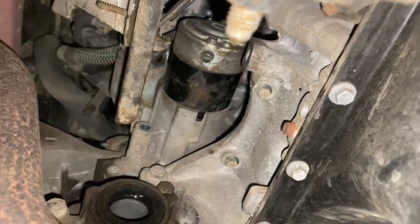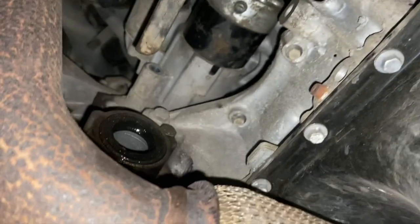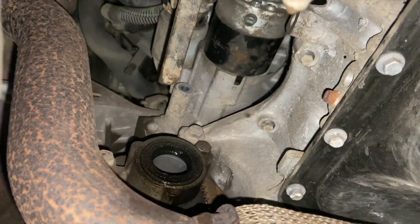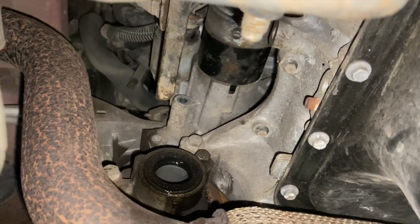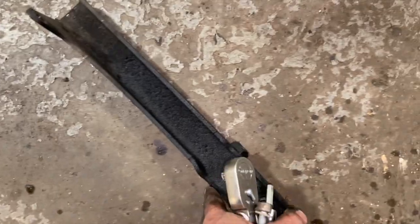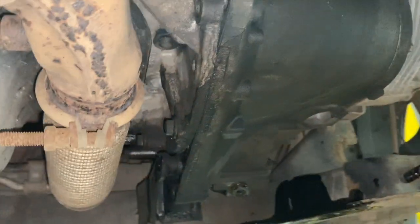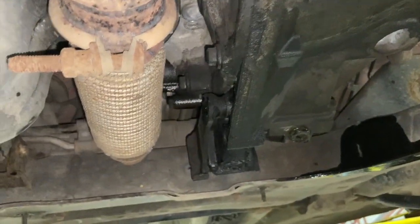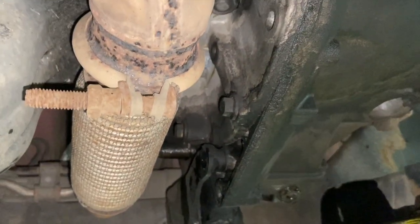There's one more bolt on the end, but it goes in the opposite way. It goes in from the gearbox side into the starter motor. So what I'm going to do now is drop it back down and get the bolt out from on top. We'll get the gear change cables off next. I did just take this support bracket off as well. This big black bracket just sits over this section of the gearbox. I've taken that off, and I'll show you getting the gear change cables off now and getting that starter motor out.